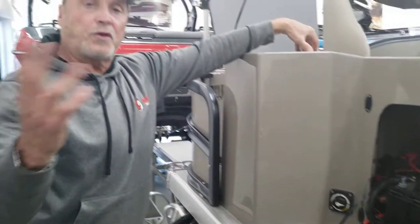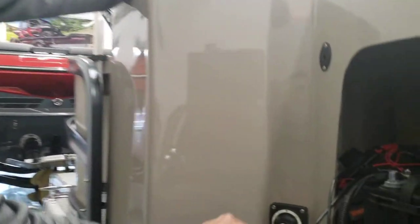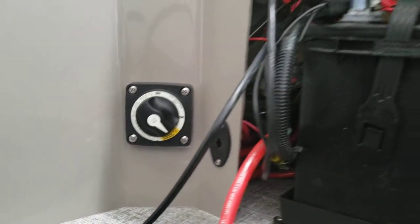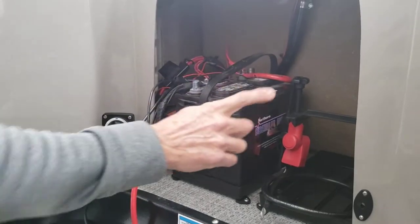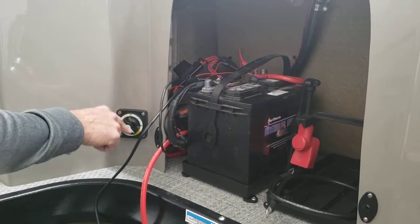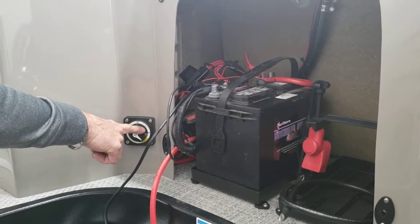With this on, you come off the lake, you get off the pontoon — let's say you forget to leave your depth finder on. You come out the next day to start your pontoon and it doesn't start. This is where the second battery comes into play in the combination switch. You would now switch it on to the combination switch and start your motor. The motor should start because this is the backup battery that's still charged, and that's not been drawing because you only kept it on this one on position.